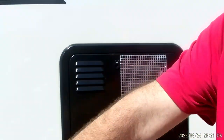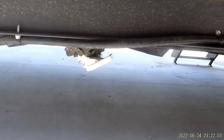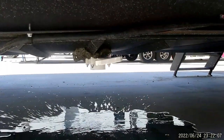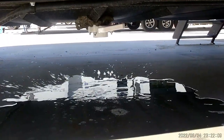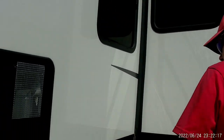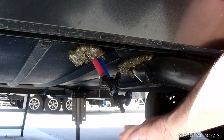Quick step back — our first water drain is going to be located right down here. It's a two-inch drain valve and it will drain the water out pretty quickly. I did have some water in the systems to show you that. Next, we do have our low point drains, also located down here. You've got your red and blue — pretty much hot side and cold side.